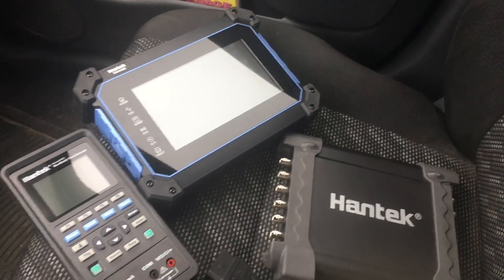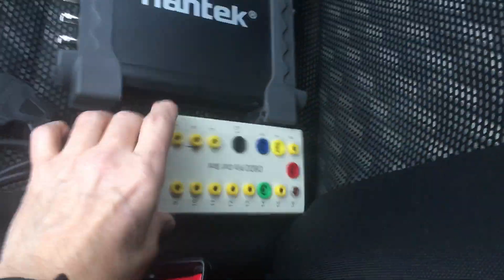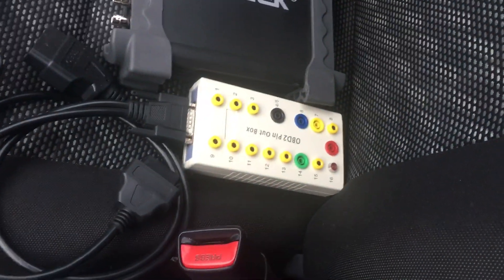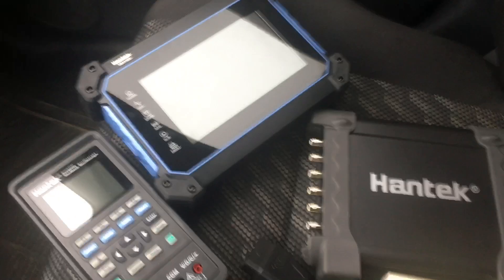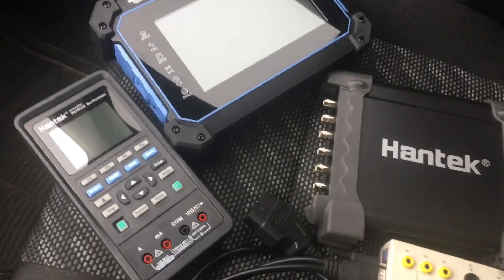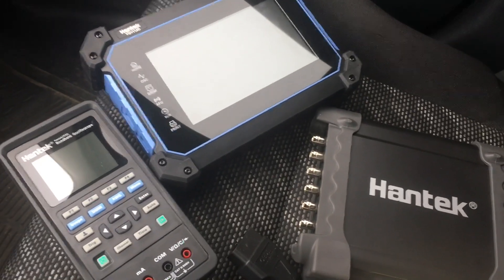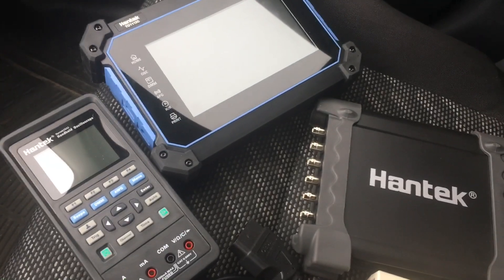You can see here I've got my breakout box - a cheap little rig, slightly modified - just so I can break out the CAN bus. In my generation car, a 2009 SX4 as some of you are aware, the CAN bus is by far the fastest signal in the car. More modern cars likely have entertainment buses and possibly FlexRay faster than CAN.